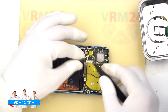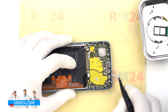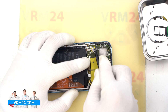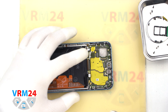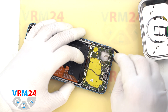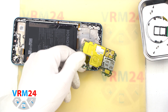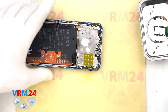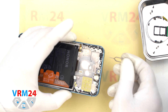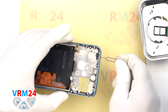With the cameras removed, we can start unplugging the rest of the connectors: the interconnect flex, display cable, side button cable, and the two coaxial cables. Now we're ready to remove the motherboard — gently pry it up from the correct spot and lift it out. There's another mic hole at the top of the display frame with the same L-shaped design. The mic is on the back of the motherboard, so you won't damage it by sticking anything into the hole.